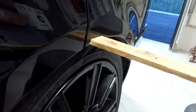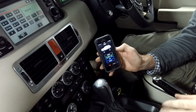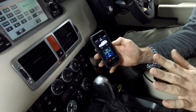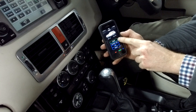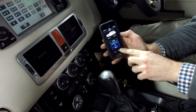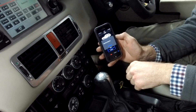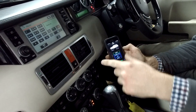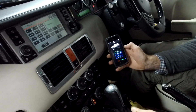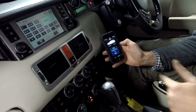You'd use access mode in a car park or when you want to get in and out of the car. Now I'm going to set it back to default so you can see the changes — I've set it to default but that hasn't changed anything yet until I program it. Save changes to the vehicle — failed, because I haven't put the ignition on. You've got to leave the ignition on for about 20 seconds.